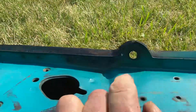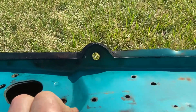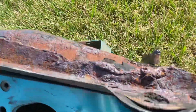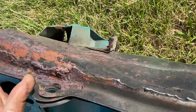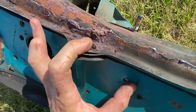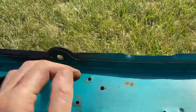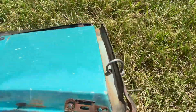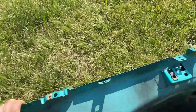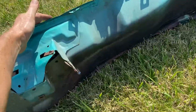And although I do see some discoloration in the paint, and maybe there's a little bit of paint missing, there's no blow through, no char holes, no rust or anything. It all seems to be on that bottom layer. It looks like 3 layers. You got this bottom layer, where's my finger? Bottom layer here, middle layer here, and top layer here that you're gonna use. Let's see, any other concerns on the bottom? No, I just went far enough around. Good clean windshield trough underneath. I left enough metal here, so let's look at the top and the front.